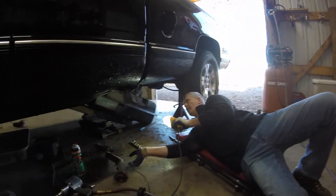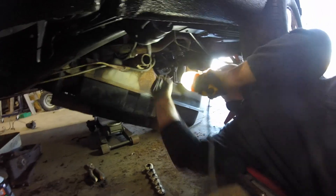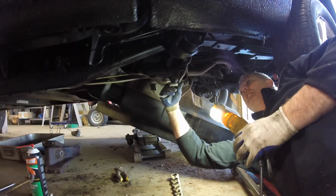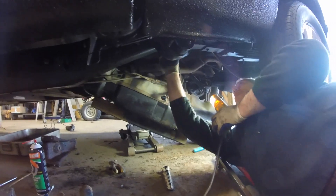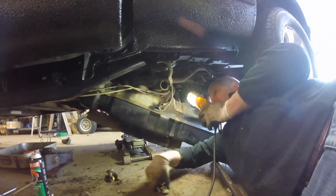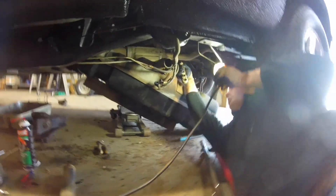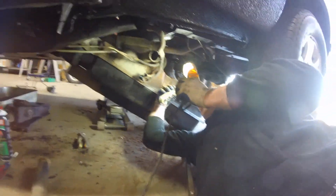What we did, we went ahead and we took the fuel filler neck off and we disconnected the electrical lines. As you can see, we've got those coming right off. This is going to be for your fuel sending unit and also your fuel pump. This here is the filler neck and this is the vent line to the tank. Basically we're going to have specialty tools — you are going to need these. They will go inside the fuel line connections themselves and pop those lines off.